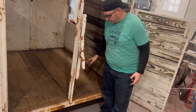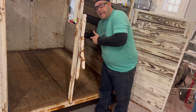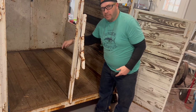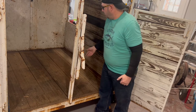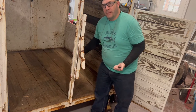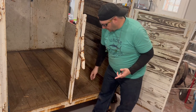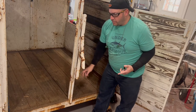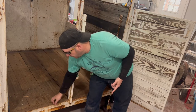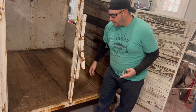Alright, so on this floor — this is kind of an odd setup. Usually the boards are set in under a lip on the back end or front end and then bolted with carriage bolts through the angle iron supports underneath. So this is kind of an odd setup; this has the potential to be the original floor. Either this lip has been replaced when they put new boards in, or that front lip — which looks older — this looks like newer angle here, so I think they just cut that out and welded in a new piece of angle to get these boards in.